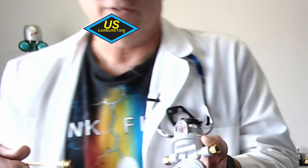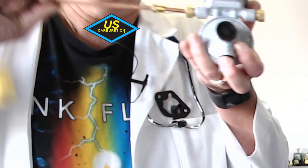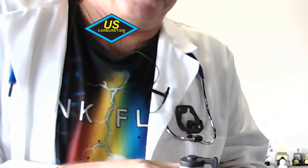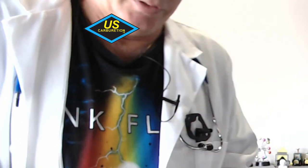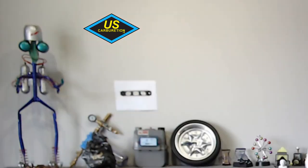using these pigtails, and they're universal. They go to either one. So they hook right in there, and they go into the cylinders. And you can disconnect it, leaving the pigtail on there. And then when you bring it back full, you know, it's still on this side, and then that way you switch back and forth. So the other device was the T-check. You can do the same thing with this, but you get no flag. It'll switch from side to side.